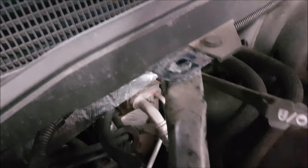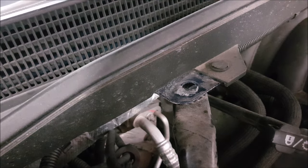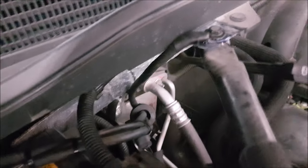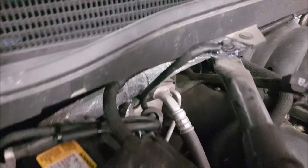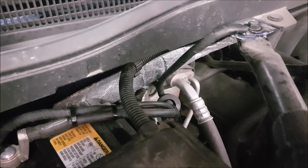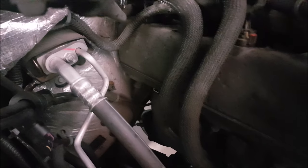We could use the 10mm down there. I'm trying to refrain from putting any new holes into the cab, so I'm just using whatever is existing. Here's everything secured — running down here, coming up and through. Now I know for the battery side it's linked up nicely with the cab, and then the factory ground is linked up nicely down by the motor.